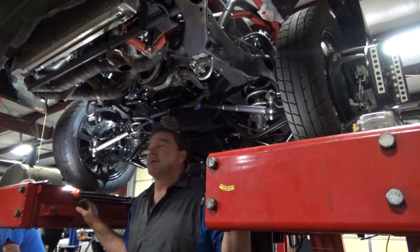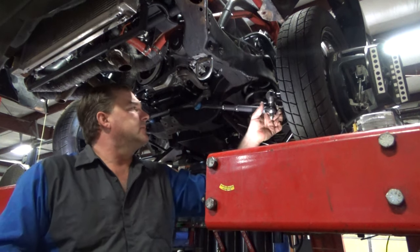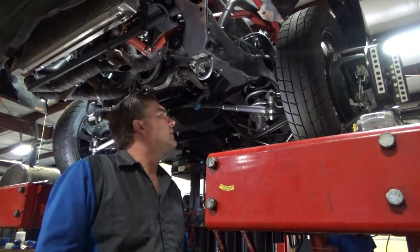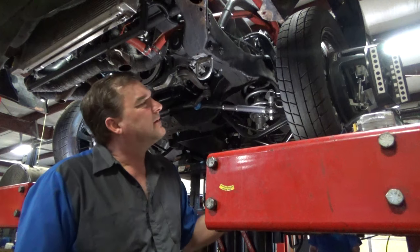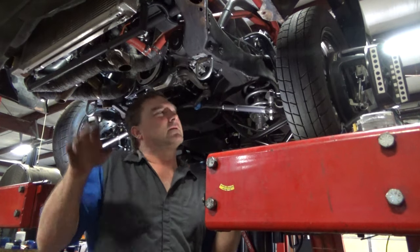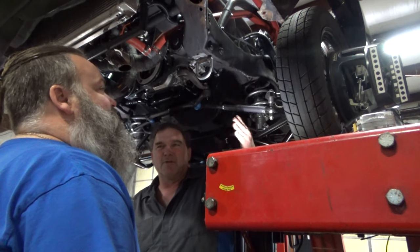What was I doing? Bump steer. Let's go. It's got Viking coilovers all the way around — Viking Crusaders on all four corners, TRZ. It actually looks like there are tire shavings all over here, which would mean he was probably steering with that tire and this one was fully six degrees in. That makes sense because the car is going to be pushed to the driver's side. You can see the black dust — that tire has been the one steering and this one's just been floating as kind of an air rudder.